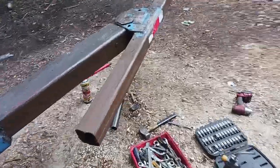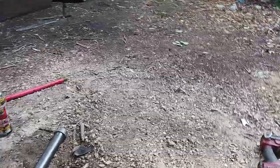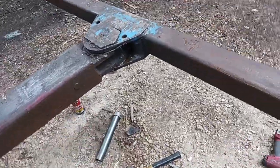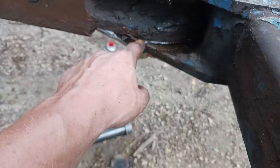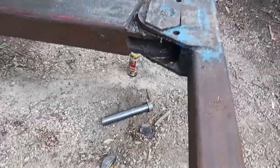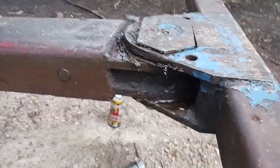One of the biggest overlooked maintenance items on a tow truck, especially a wrecker, is going to be this wheel lift bushing back here. Nobody takes care of this thing. Over time there are actually two discs in this model, and as it moves and gets used they get thinner and thinner. That bushing in there gets worn, so right now we have a lot of slop in there.